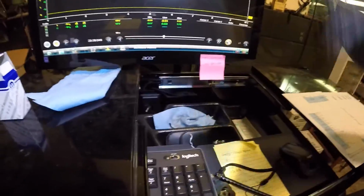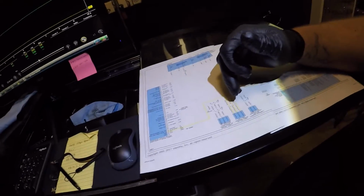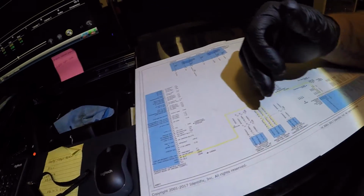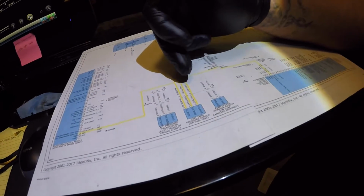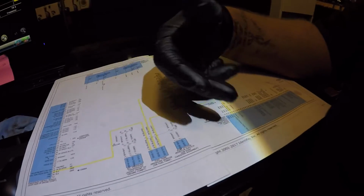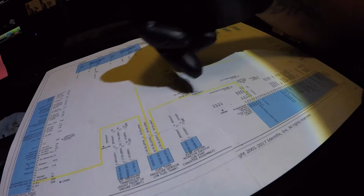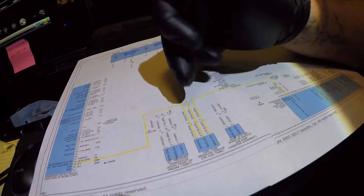Most vehicles, older vehicles especially, you won't have that. The signal wire is a dedicated signal wire. Now that 5-volt on that signal wire will do absolutely nothing when that sensor is connected. Basically, that's an open circuit sensing wire. It allows the computer to know if that wire is ever open, whether the plug is disconnected or the wire gets cut somewhere. If the wire becomes open, it's going to show 5 volts, because it's the 5 volts feeding through the resistor inside the PCM.